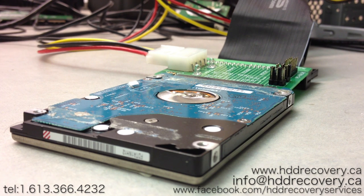What you need to do is reestablish the connection with the drive and set aside issues related to the file system or the laptop itself. Connect it directly to USB and hook it up to another machine — either a desktop or a laptop — and see if your drive starts spinning up.